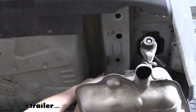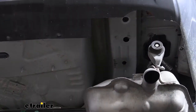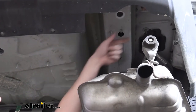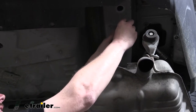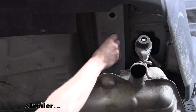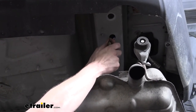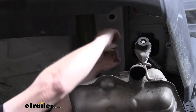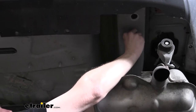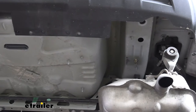There we go. And then on the opposite end, I like to put a pretty hard bend on it there, and that just prevents the wire from being able to fall through the other direction. Once we've got our coiled end pulled through like that, we can take our spacer here, slide that over the coiled end. You can go ahead and push that up into the frame. Then our carriage bolt will thread onto the coiled end. After we thread that on there, just pass the bolt up into the frame and then pull it back so it comes out the hole.